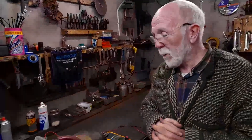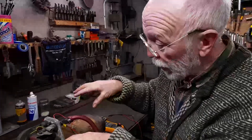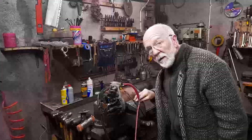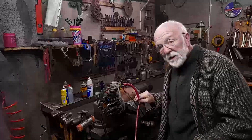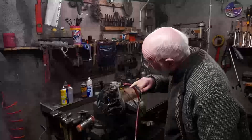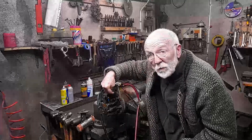So that's another one of my get-me-home tricks. And I hope I've explained the current path in this starter a bit closer than I did in the past. There's still more detail. Whenever I push the button, the coil in here, as I've explained, pulls in that switch.